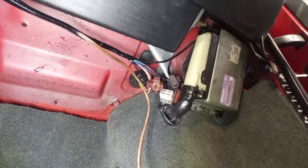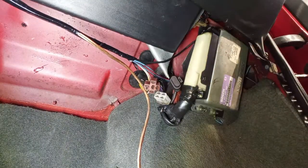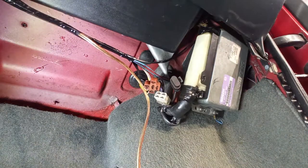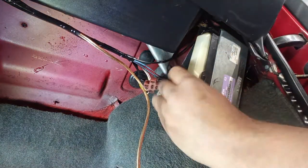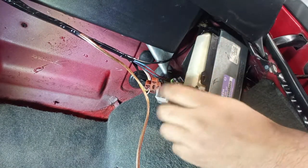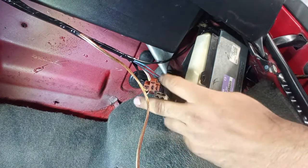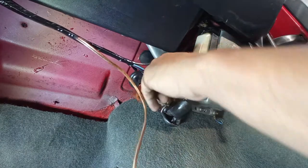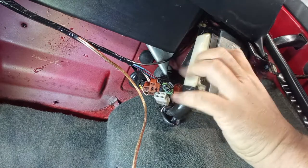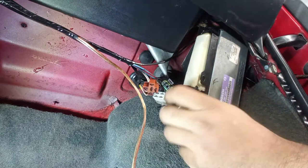Now, over the years, I saw in a lot of forums talking about these connectors over here. This car is very old, okay? In order to communicate with the diagnosis machine, with the scan tool, you have this connector over here. But before a scan tool existed, you could also connect over here, I think with a light bulb or a relay with a light bulb, a different type of assembly to tell you by blinking the fault code and whatnot. I'm not totally sure how it works.